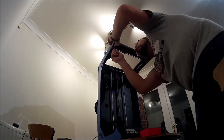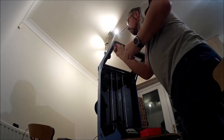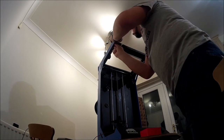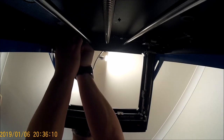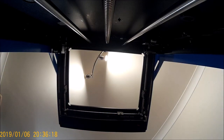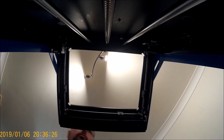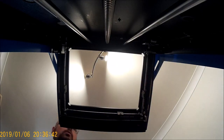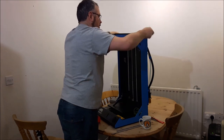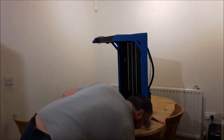We're then looking at taking the cover off the top. There's a couple of nuts at the front of the top cover of the D5S. And then if you look down the back, there's two bolts that go up from underneath and they go into standoffs that are fixed into the cover. You pull those two screws out and then the cover just lifts off and pulls forward.